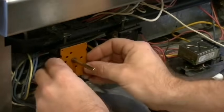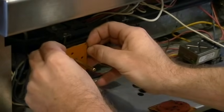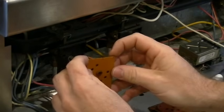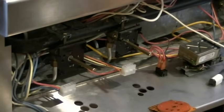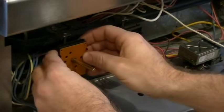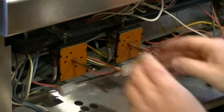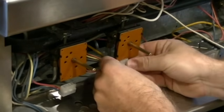And if that is the problem, then the bad burner should move from the front to the back. So it just pops off. And if it's not the problem, I guess nothing will change. The front burner will still be bad. Let's plug the power back in.